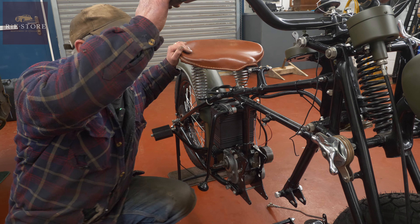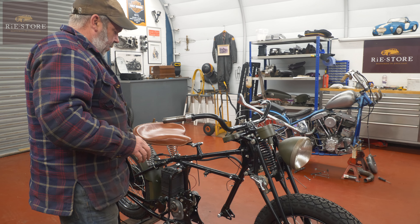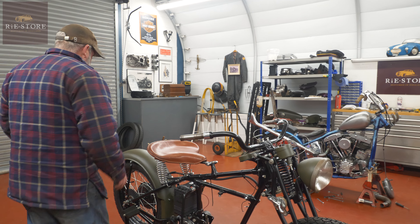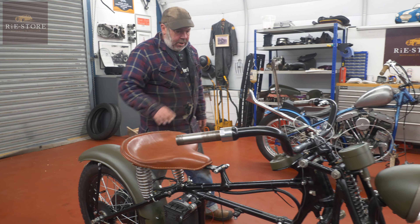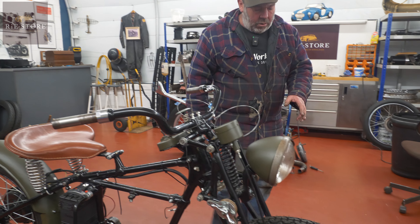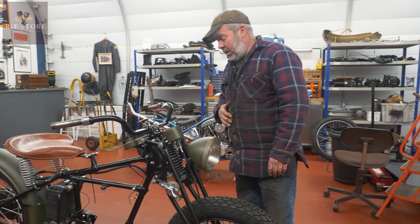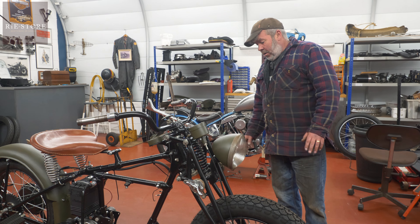The wheels are binding — it's basically just been thrown together loosely. So I'll take all the wiring out of the way to start with, take the gearbox out and rebuild it — there are shims and tolerances to sort. The back brake is binding slightly. We've got no front mudguard and the rear mudguard is incomplete. The front wheel was laced up wrong so it's been spaced off. He's not happy with this washer here, which I don't blame him, so we'll machine something up nice for it.